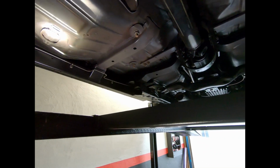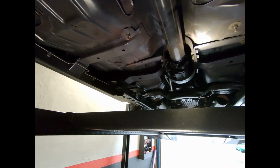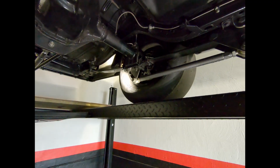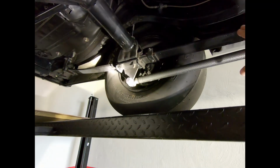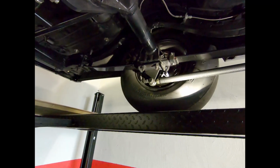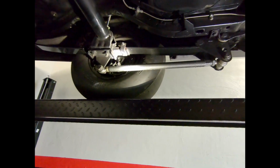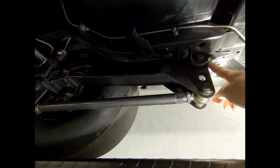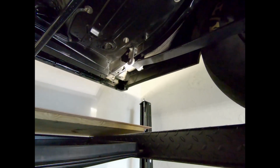And we put all new bushings, all new brake lines, new U-joints. You know, we're required to run a drive shaft safety loop. The rear suspension must be stock. You are allowed to change leaf springs. We run Calvert split mono and Calvert bars, Caltrac. And it's got solid bushings in the front, rubber bushings in the rear.